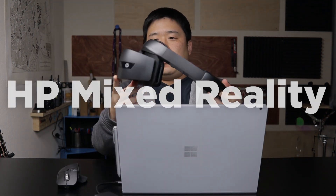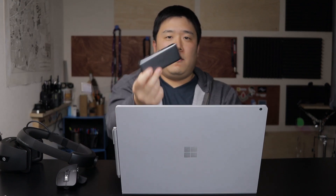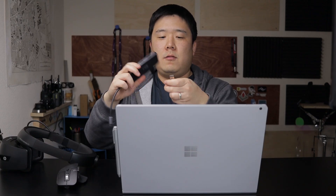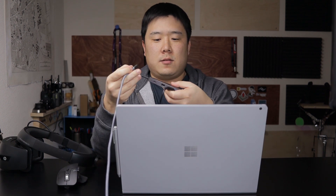This mixed reality headset is my choice. By the way, I have purchased an Oculus Quest and I'm expecting a lot of good things about it because there's Oculus Quest Link — I'll get into that later, perhaps as part of an unboxing video. But for now I'm going to use this headset. The other end is USB 3 and HDMI. I also have this USB-C hub from VAVA — I'll leave a link in the description. It has USB 3 and a bunch of other ports including HDMI and Ethernet. I'm going to connect USB 3 there — make sure you connect to USB 3, not USB 2.0 — and connect HDMI. I also have power delivery USB-C connected to the desk, so the laptop is powered through the power delivery port with everything connected via USB-C.